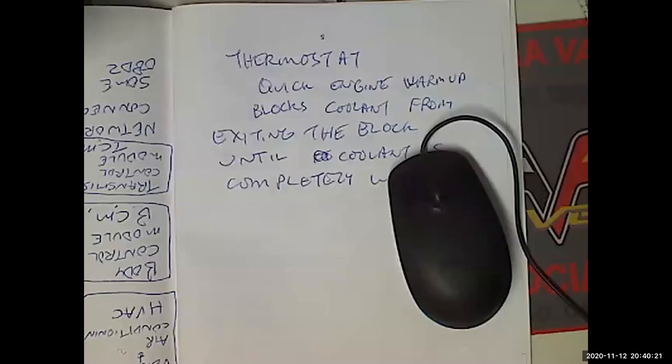Oh my God. Inspect, adjust, and replace external manual valve shift linkage, transmission range sensor switch, and park neutral position switch. Boy, that doesn't seem entry level to me, Chuck. Mm-hmm. Yeah, because that involves an adjustment, right? And if you got that adjustment a little bit off and it wasn't really in one gear, it was in two gears at the same time, you burn up that trans really easy. Okay, let me put it this way. We should be able to come in there and do a visual inspection of high quality. Visual inspection meaning all the linkage is in good shape and all the components are in good shape. But I wouldn't want someone entry level doing that adjustment. That doesn't seem like entry level work to me. And there's so much at stake.